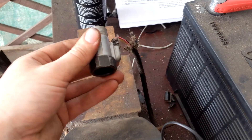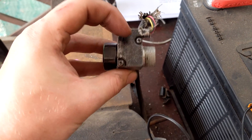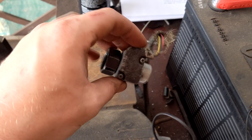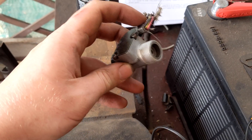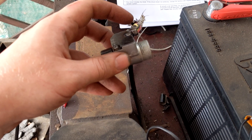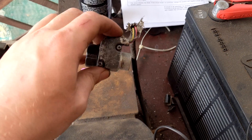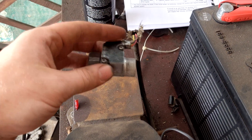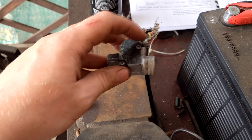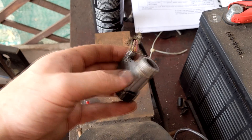I took the sensor off and gave it a clean up. You can actually take this top plate off, pull the magnet section out, and clean it all up. I brake-cleaned the whole thing and took the wiring harness out. This had a bit of damage - it's been hit at some point and it was flared up. That could have broken the wires internally. The wires, I couldn't visually see that were broken, but there's a rubber section that goes like this. When this bent up, it possibly could have torn those wires because they'd be quite tight inside that rubber - they're all sealed.